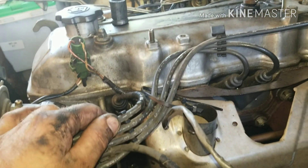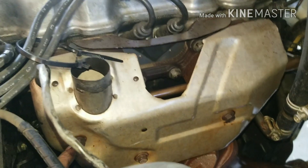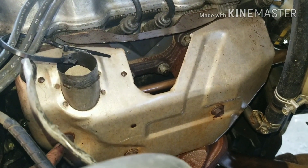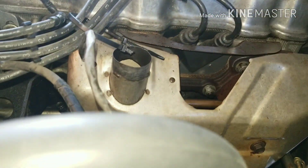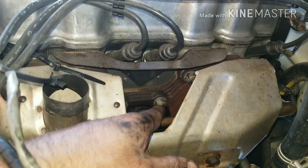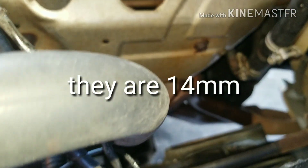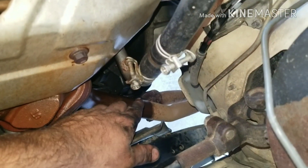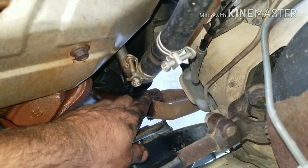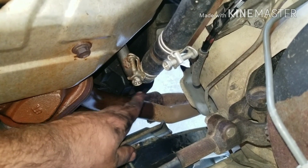The wires are already marked one, two, three, four, so that's easy — no need to re-mark them. Next, go after your exhaust shield. These bolts are 13mm and 12mm, with 12mm bolts in the middle. Take those off and you should be able to just pry the exhaust back out of the way. On other models there's a flange on the pipe that mounts to the engine — this one doesn't have it, so no worries.